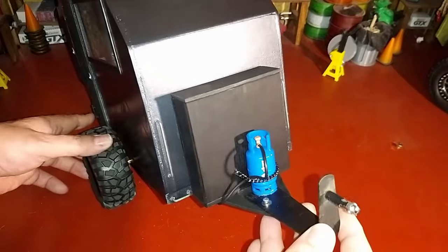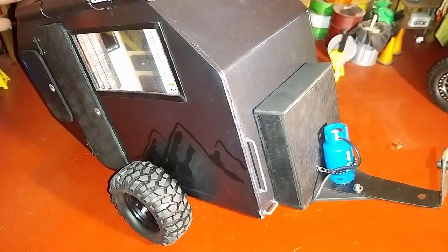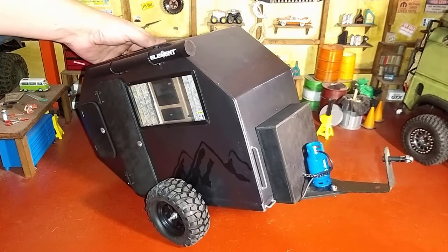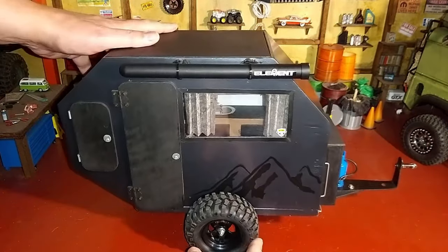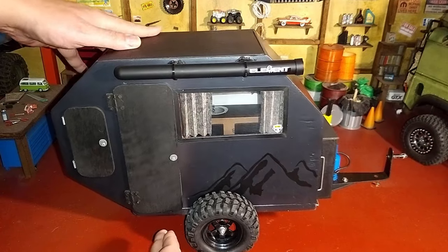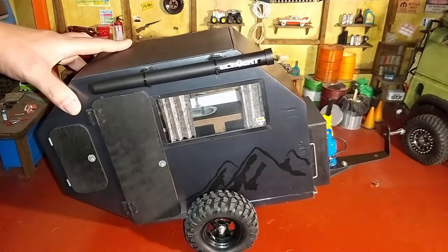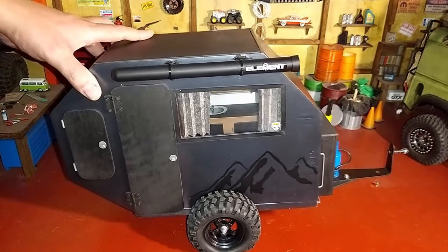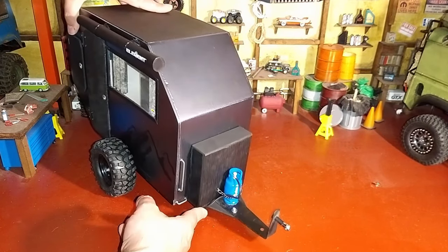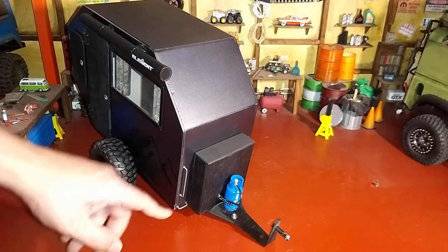At the front I've added some grab handles for another little bit of realism. This box wasn't originally there, but what I failed to incorporate into the design was the balance of the trailer. Before I put this box on it was very tail heavy — the wheels don't actually sit right in the very center of the camper, so I can't move them back any further because of the door. I had to put some weight up the front because it was just lifting the suspension of the Land Rover. So I put this box on the front which is full of lead — I used some lead flashing that you'd put around your roof tiles, all folded up.